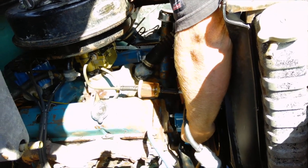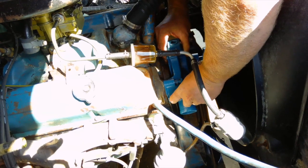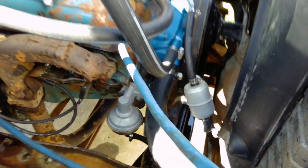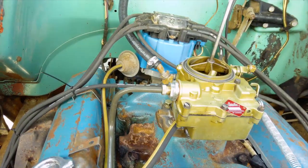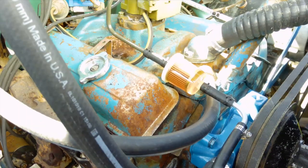Just getting a couple of bolts started through here, one on the opposite side — got that gasket in place. Lower hose on, heater hoses on — new heater hoses. Water pump on. Pulleys on. Belts are on. I went ahead and changed the vacuum line too — the old one was all cracked, so I used a half-inch fuel line for that, gives it a little more support. The fuel line situation I'd like to eventually go all metal. Down here is a 3/8" line and up here is a 5/16" line because of the two-barrel carburetor, but it's 3/8" coming out of the fuel pump, so I'm going to bend up a new 3/8" line so we just have the one fuel filter.